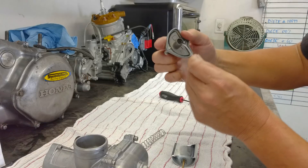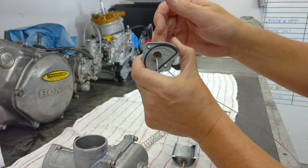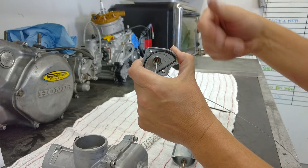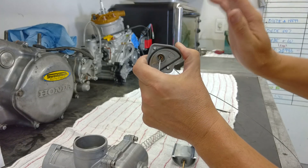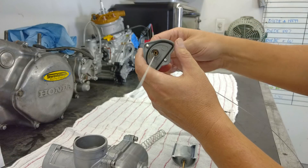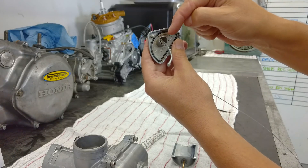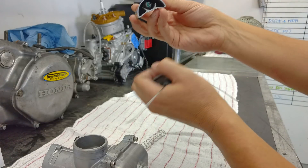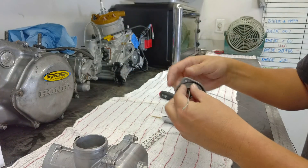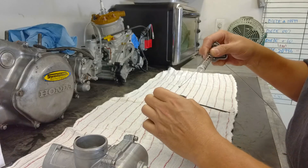The other thing is inside you'll see the throttle cable adjuster. There are some cables that have a 90-degree bend on them — they're screwed into the cap and have a lock nut. I personally hate those things. It's a pain to pull the cap on and off, and they just get in the way. They look clean if you don't have to work on anything, so if you've got a show cart they're fine, but if you've got a race cart, get rid of it. Also watch out for longer cable adjusters that stick down into the cap and actually hit the slide, which doesn't allow for full throttle — that will also give it a different sound.